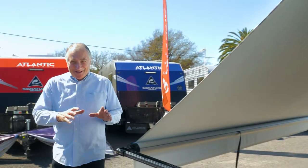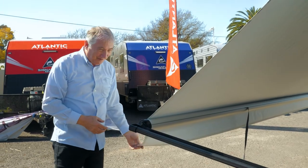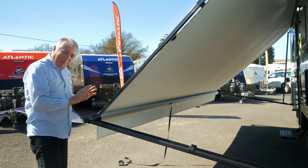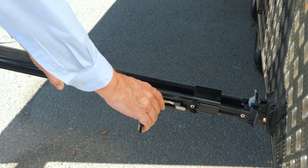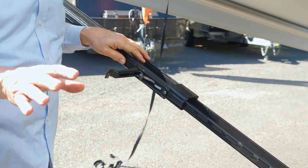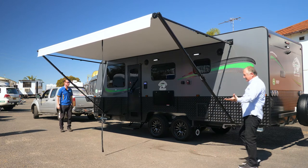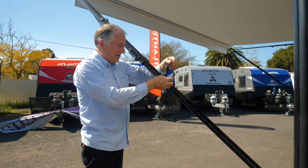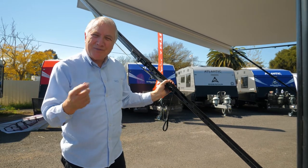To have the awning set up, make sure this flap is visible - pull the whole awning out so you can see that flap. This just comes out, comes right up, and goes into the black bracket. Open that handle up, there's another little button there - pull that up and close that off wherever you want. If you're doing it solo, it's best to go about halfway first. Here's a handy hint from Paravans: pull the cord along the track and tie it up so nobody trips over it. Before you drive away, make sure you put the awning away by reversing those simple steps.